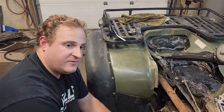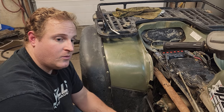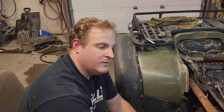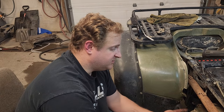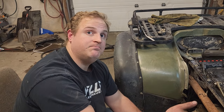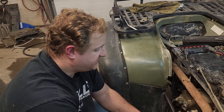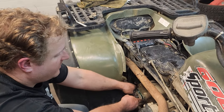So that you have to have your foot on the foot brake to go between reverse and park or high and low. And we think the reason for that is to stop you from grenading the transmission. And that the reason you don't need it to go from reverse to low is because neutral's in between them. It's factory idiot proofing. Yeah. So what we're going to do, because we don't have that spring, we're gonna unproof the idiot.